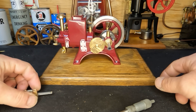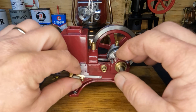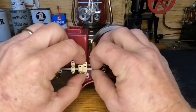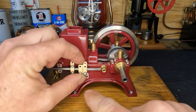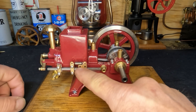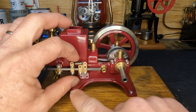Let's get this installed and keep moving forward. We got our cam gear back off, go ahead and put our push rod back in here and get all that started. We've got that spring on here that holds it back, so when we go to put our cam on we're going to have to pull it that direction and get those tightened up. We're going to put our front back on and get those tightened down.